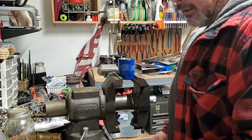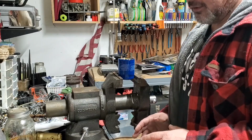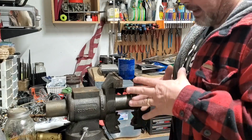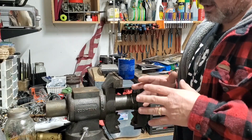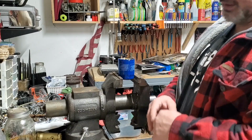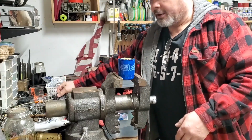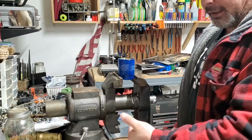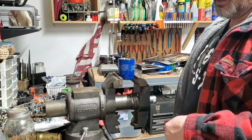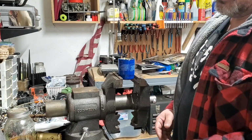If I wasn't clear on all the testing, because I've had to hit and miss back and forth, there might have been some I missed where I forgot to hit the record button. But what I have found was idle oil pressure was too low. It was around, indicated zero on a mechanical gauge, but I don't know what it showed back at the PCM. It wasn't enough to set off the oil light. It was not enough to set off the code, I believe, on those that deal with low oil pressure. We never had those issues, just the VTEC.